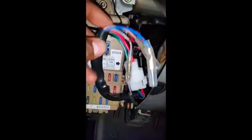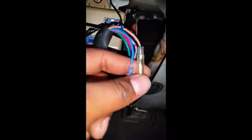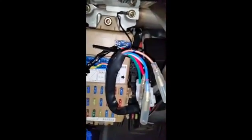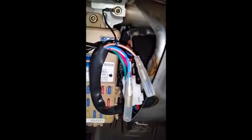Got that ran, and I got this ran. So gray goes to gray, goes to the e-brake. That I found out is speed, so I have to find a speed sensor later on, and that is RPM. So it can do some calculations on the RPM and speed, and set the turbo timer correctly if it's set for auto, I guess. Apparently I need those two, but just to hook it up right now, you can set it for a timer and let it go.